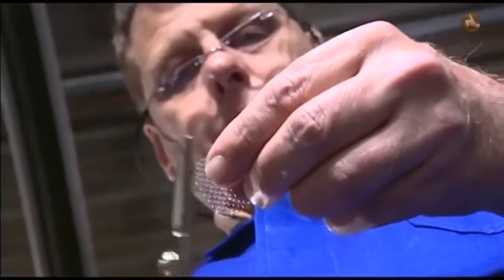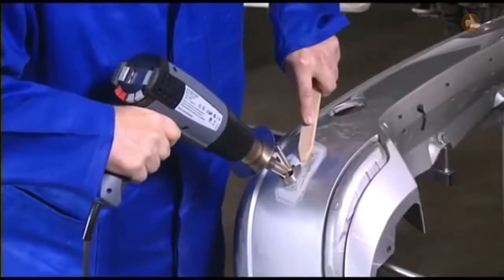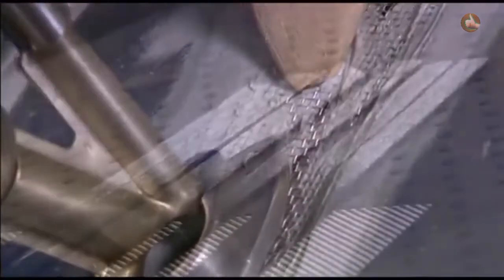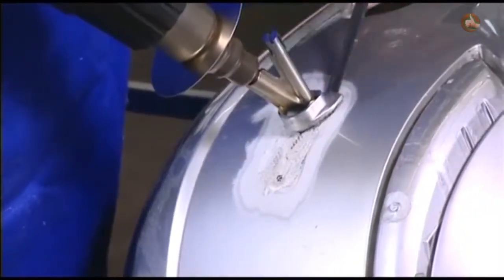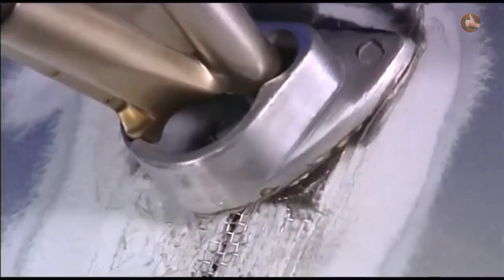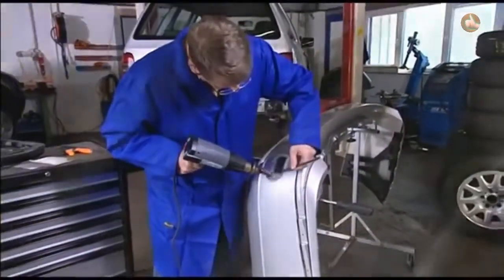Uniformly soften the rounded gauze with the plastics repair nozzle. First secure one corner, then heat the complete gauze and weld it into place. Important, the plastic material must penetrate the gauze completely. The multi-thermoflex welding rod must then be incorporated. To produce a good bond, the welding rod and area to be repaired must be carefully and uniformly heated. Gradually smooth the material around the edges when the welding rod and substrate have completely melted into one another.